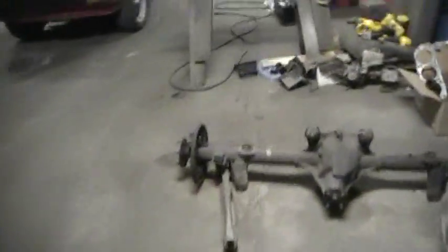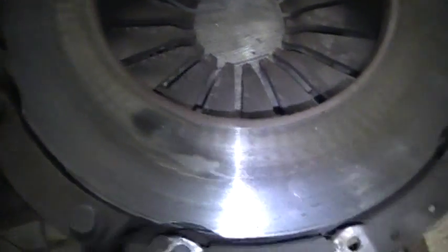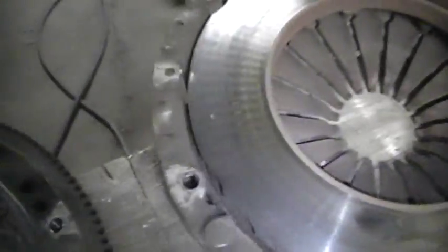This is gonna be your call, Joe - the clutch. It's not that old, but somebody was beating on this thing. See the heat marks on the pressure plate right there? And there's the disc. There's the flywheel with heat spots on it too. I don't know - if you want it perfect, clutch kits don't cost that much. We'll add everything up - I've got a big list of parts.